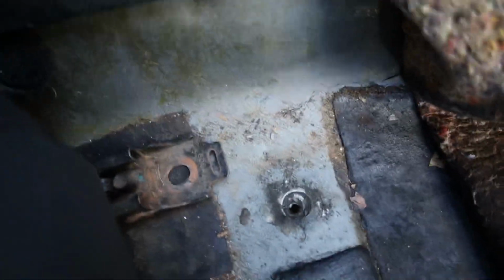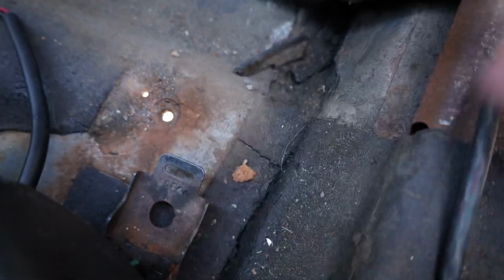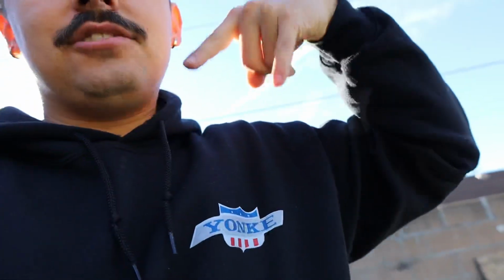And so if we were to mount it here, I would draw a little circle with the marker, take the seat out and just drill my hole right there. Same thing with this one, and that would be an easy way to mount the front. Once the front is mounted down, we could hook up the power seat and recline, slide it all the way forward, and then get access to the two back ones and do the same process all over. Mark the holes, drill them, weld the nut, and we're good. So we're gonna get to doing that. I'll keep recording a few clips as we go, but we're gonna get this thing done.